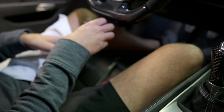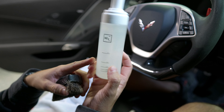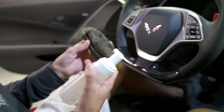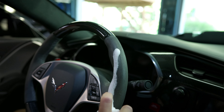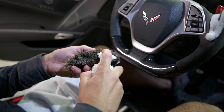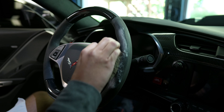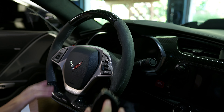So let's show the process here. We take a little bit of the Polestar — one great thing about it that we didn't mention earlier, it's colorless and also odorless. So what we're going to do is basically put a little bit of the product on the Alcantara, and then put a little bit on our boar's hair brush. Just excuse this brush because it's seen better days, but it works well. We'll put a little bit here to start breaking down any of the oils and dirt, put a little bit on our brush, and then we're basically just going to work the product in. I'm going to work on the face of this first before I go to the sides, because the product is soaking into the Alcantara versus spreading around like on a leather surface.